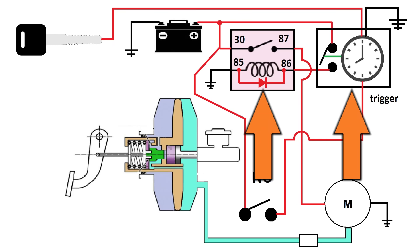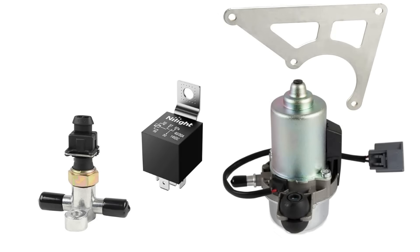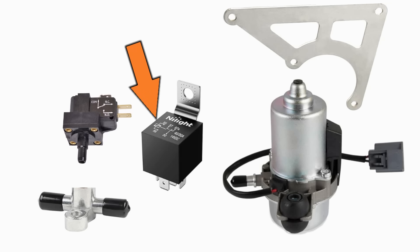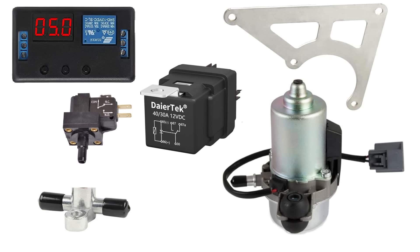It would be nice to combine this timer and this power relay as a single unit, which would greatly simplify the circuit, but finding a low-cost time delay relay in the right voltage range is really difficult. A few people suggested Automation Direct, which I'm familiar with, but they don't have what I'm looking for. For now this will be fine. These are the parts we started off with — this vacuum switch was not compatible with the way the system was wired so it went into my junk box, but we kept the mounting base and screwed a brass nipple into it, connecting the new switch with a rubber hose between them. The original relay was replaced with a relay with a snubber diode, and we used this programmable time delay relay to tie it all together. Between the vacuum switch, the relay, and the timer, we added an extra $50 to this low-cost project — making a grand total of about $150 to build this system with off-the-shelf parts.